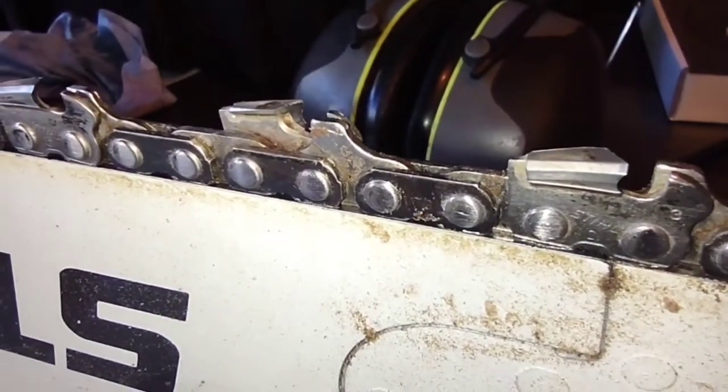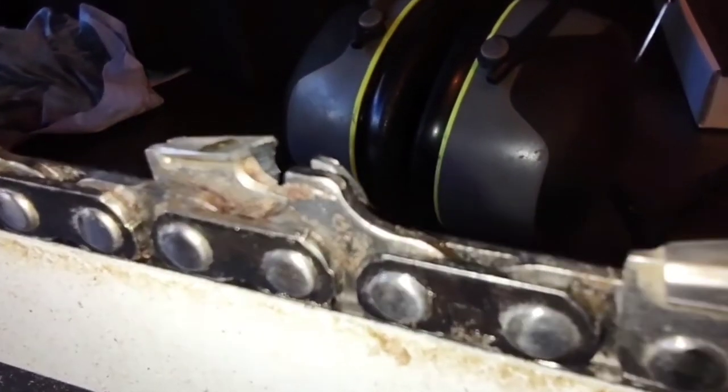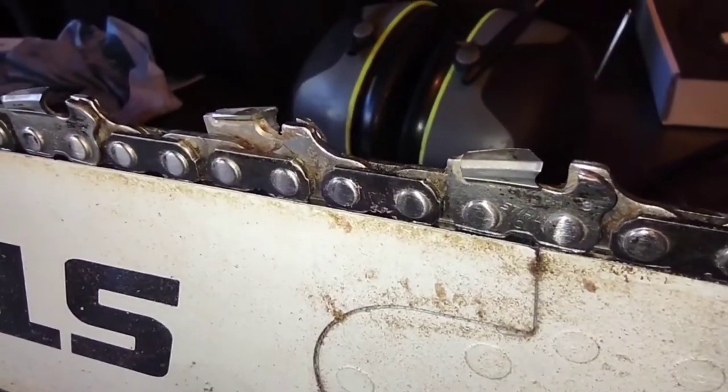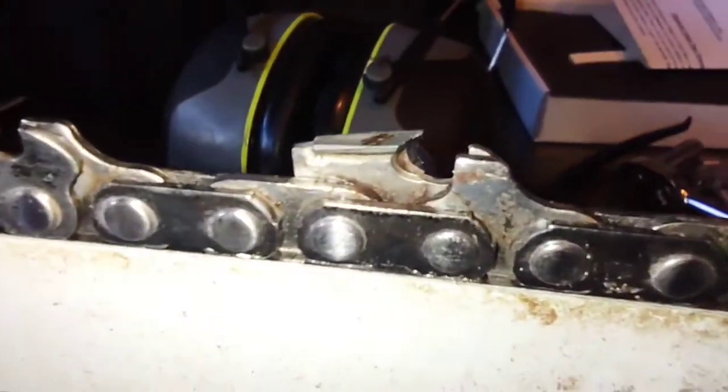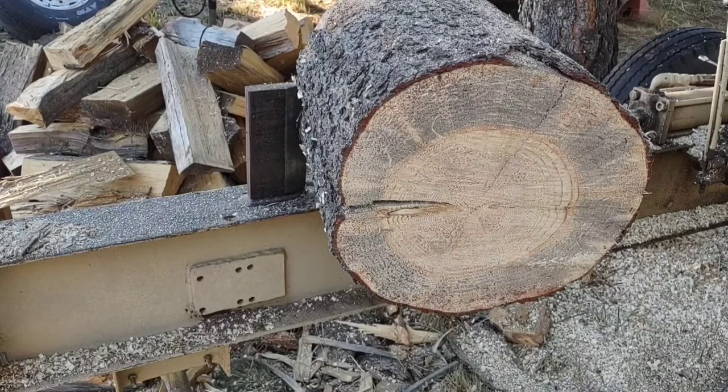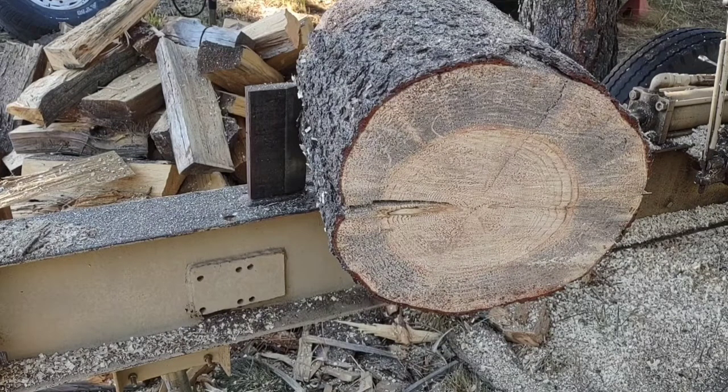there is the very same chain sharpened. Alright, so the same sharpened chain, and I guess I should mention I'm at about a couple thousand feet elevation. The saw is tuned to approximately 13.5, 25:1 Echo Red Armor oil with Avgas, and AMSOIL bar and chain oil.